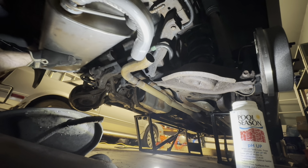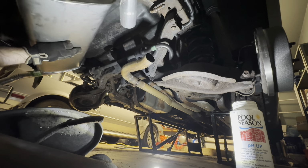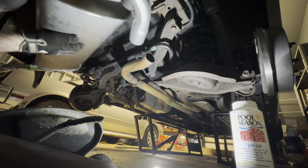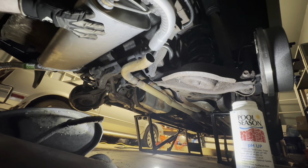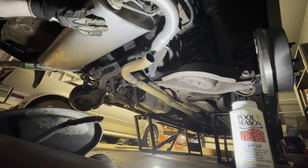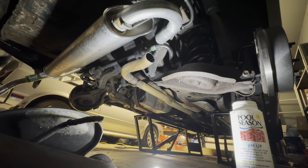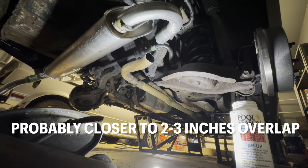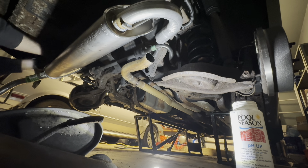And then you just clamp it in place with a muffler clamp. I don't remember the exact size offhand, but I'll have that link down in the description as well. Once you do that, you just tighten down that muffler clamp, make sure everything is nice and solid. Maybe give the pipe a jiggle and make sure nothing's going to pop loose. But you should have a decent overlap, at least, I don't know, 3-4 inches or so for that muffler clamp to kind of bite down into. Make sure it's not going to go anywhere.